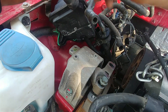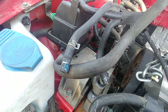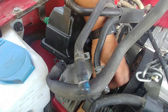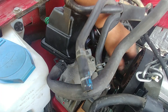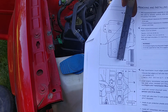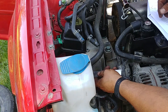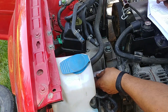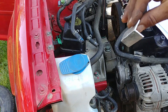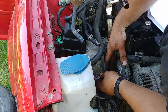Now we need to put the engine bracket and chassis bushings all together. Align the holes and start them by hand — it should be free. There are A and B dimensions — upper and lower — that you need to check. Measure to make sure it's not sitting at an angle to one side or another. You need proper spacing between the pulleys where the bracket sits — watch for those clearances and you'll be fine.